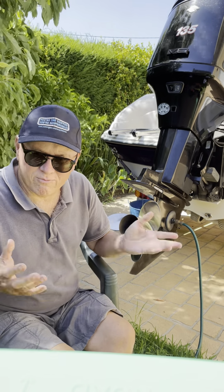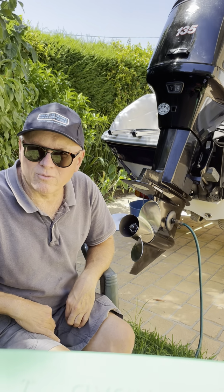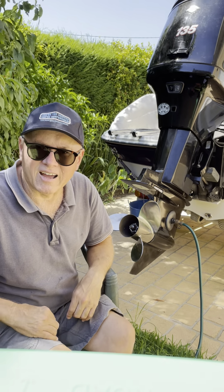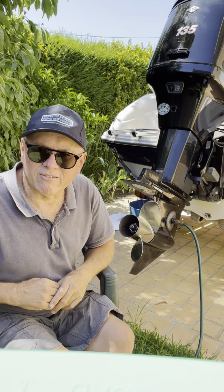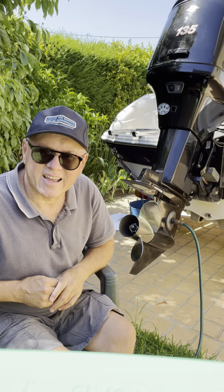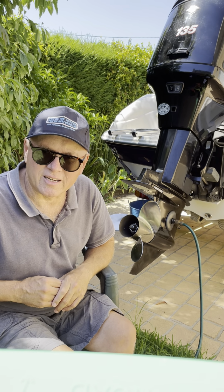You don't have to rev it up or anything, just, say, up to that 1000 RPM, 1200 or whatever. Just cycle it through the gears, make sure everything works, let it run for 10 minutes or so, and believe me, it'll be the best thing you ever did.